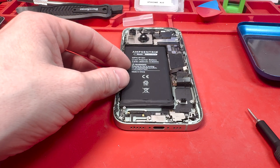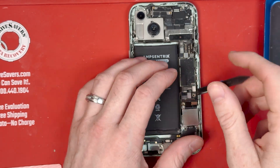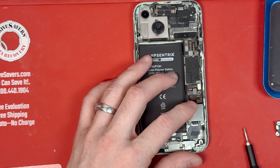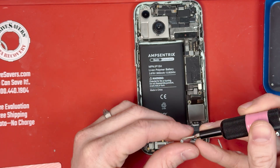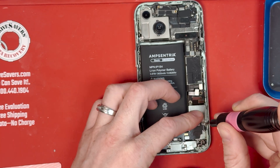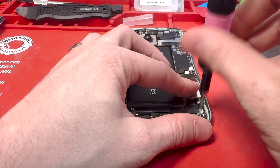We've got to put the SIM card tray weight back in. Get your spudger and lift the board on the right, then rock the board gently to get that piece underneath and grab the standoff screws that hold it. Be careful not to rock the board too hard because you don't want the screen to de-attach.